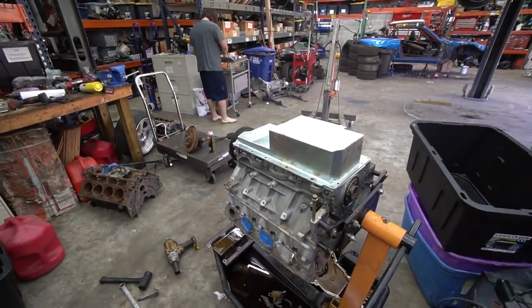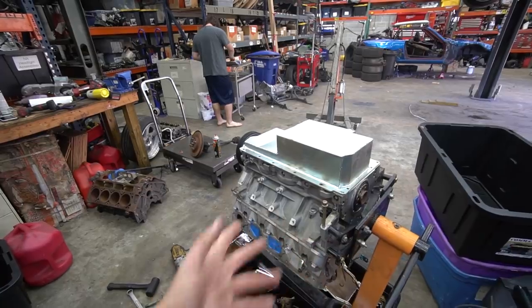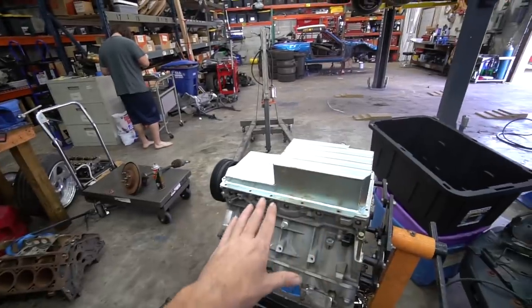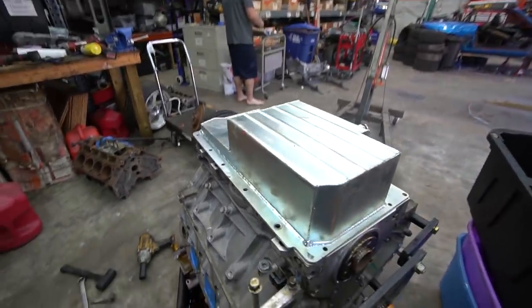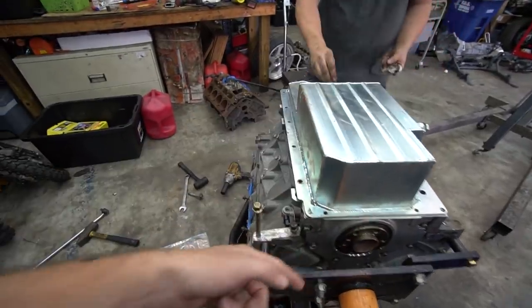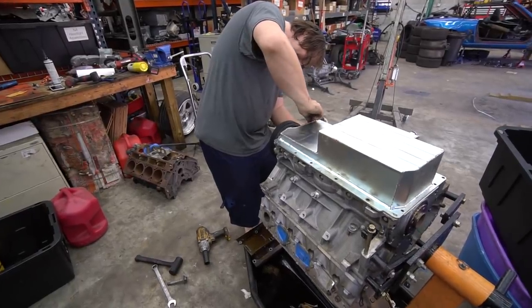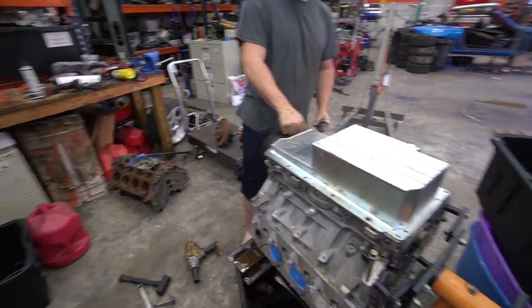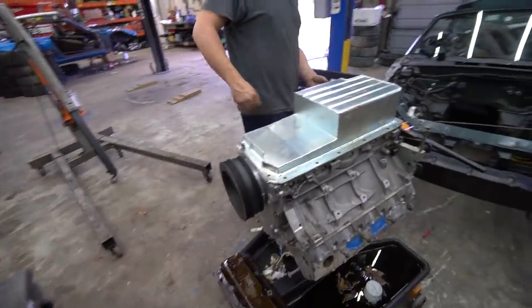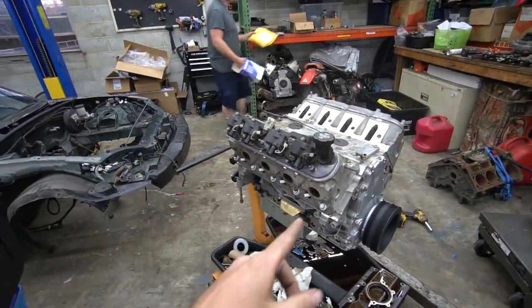It should be solid — kind of an interesting test. Tons of people run a nice baffled pan with AccuSump, no issues. You just got to put bolts in, tighten her down, and we can move on to clutch on, trans on, put her in the subframe, put her in the car. Ben drove my car this weekend — I was hoping to give him some extra motivation. The engine is just about ready to go in. We need to work on the accessories.